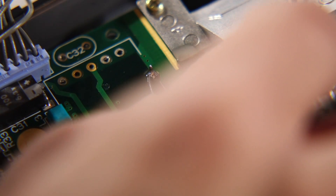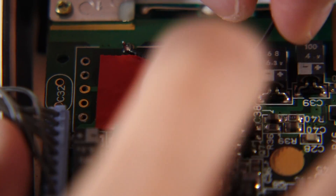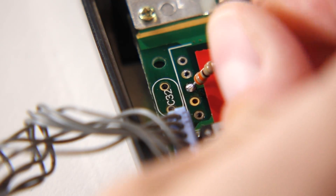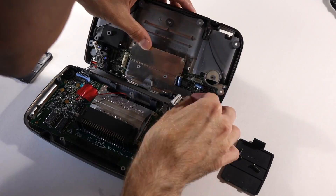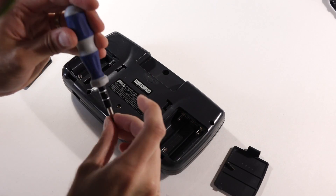The hardest parts are over — just a bit of soldering now. The black wire from the backlight can get soldered to the single pad underneath where the transformer was. I put a piece of electrical tape on the board, then trimmed down one of the legs of the resistor that came with the backlight. It needs to get soldered to the middle of the five solder points, right next to where it says C32 on the board. Then trim down the other leg and solder the red wire to it, and put another piece of tape over the top just to be safe. After all that, just reconnect the cables to the back housing, put it back together, throw in some batteries, and give it a test.